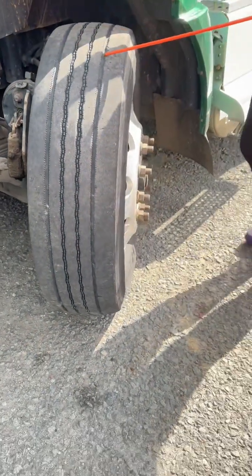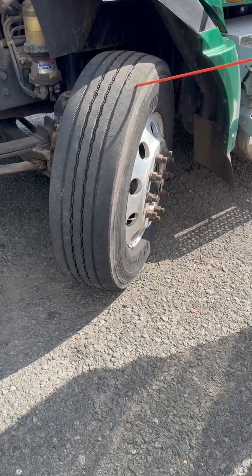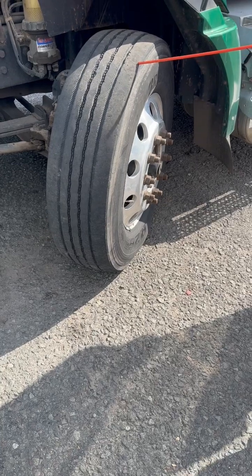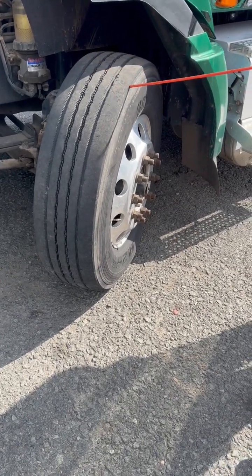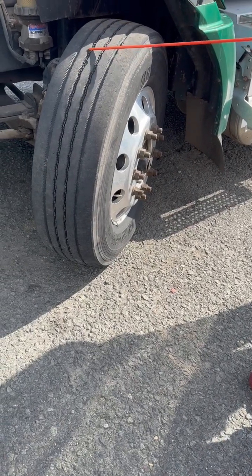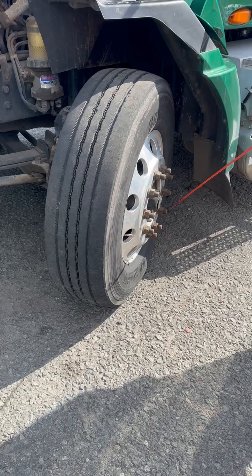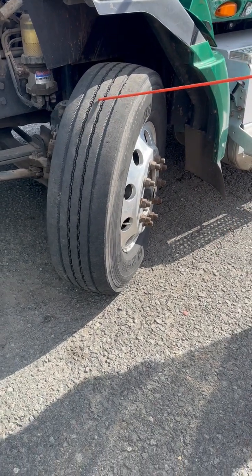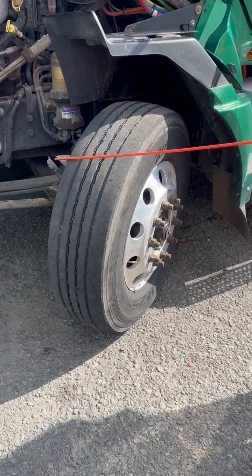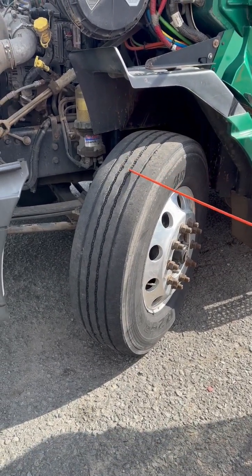Work my way out to my steer tire. My steer tire must be a virgin tire, must be evenly worn, must be no less than 4/32 of tread depth, must be the same brand, must be the same size. What I do to this side, I must do to the other side. And it cannot be retreaded or remanufactured.